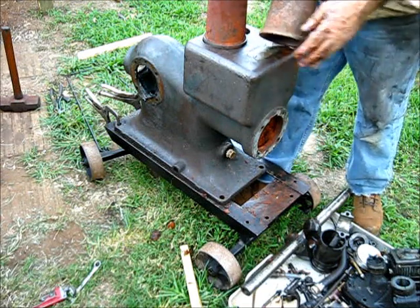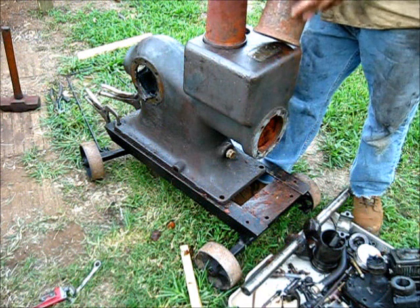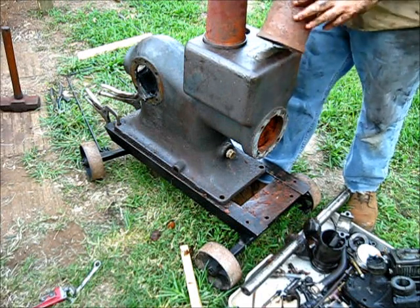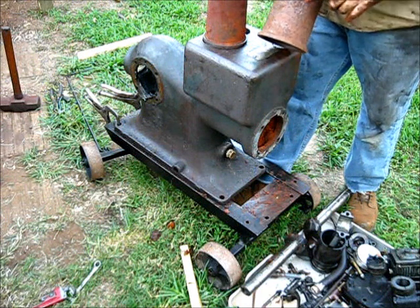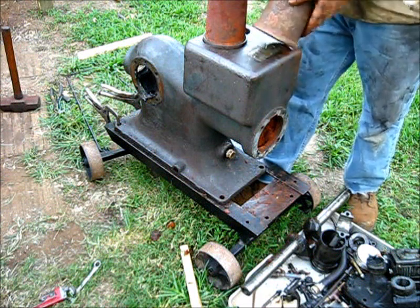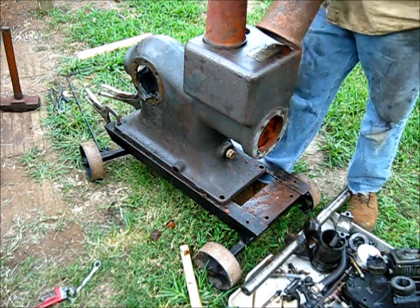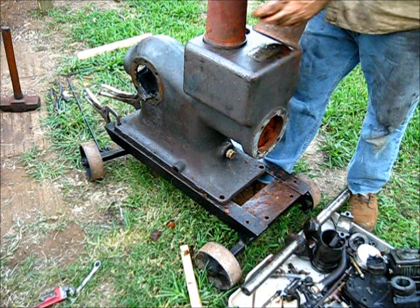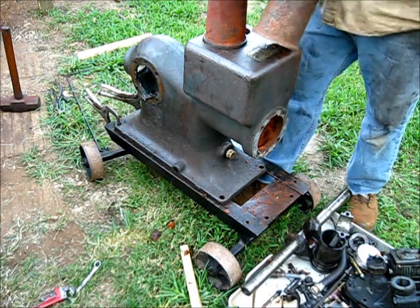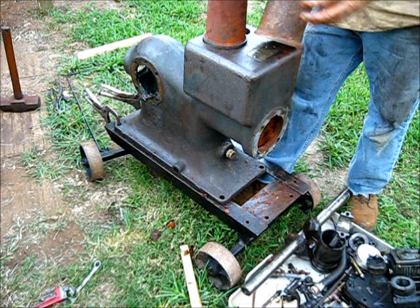Don't use anything to fill the pits. There's a question about what color to paint it — I electrolysis everything and usually paint it with a flat black rust paint, just a flat black coating. But you do not want to put any bondo or epoxy, no thick coating on the outside. You don't want to do that because of heat transfer — the heat transfers from this cast iron out into the water and then into the housing and cools it. If you apply something on here to slick this up, then it can't cool itself.